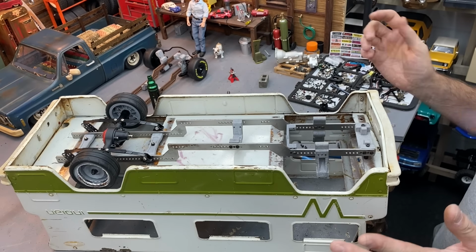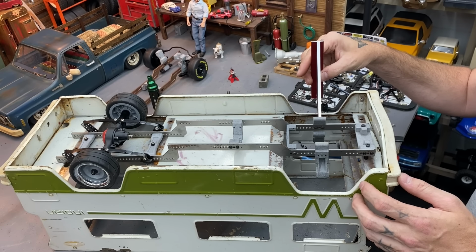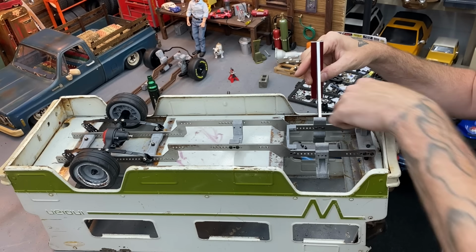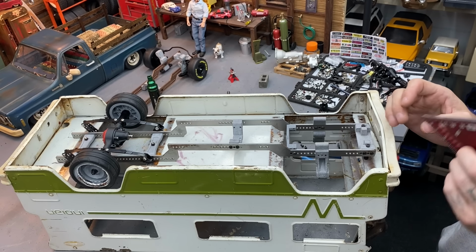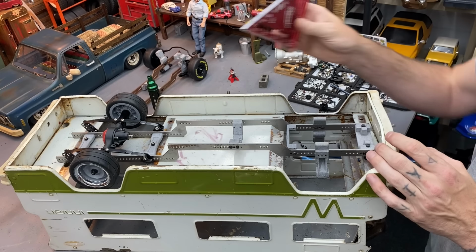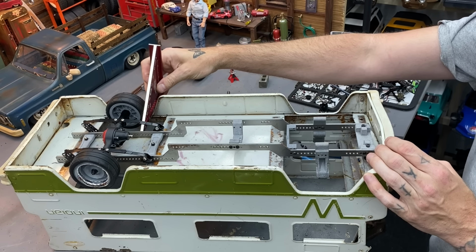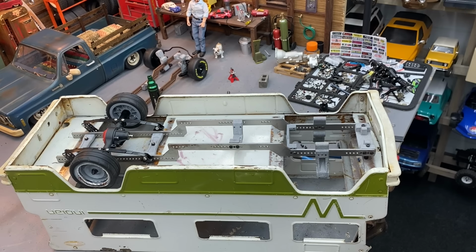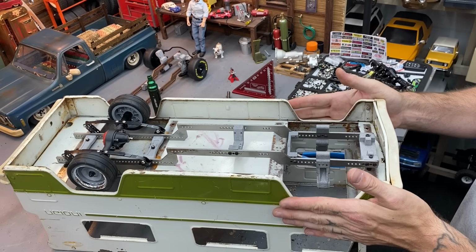Little wire management. The only thing I can recommend is just measure everything. This is right at about 2.5 inches from the inside of my shock mount to the inner part of the wheel arch. We're talking a millimeter off to the side, because drilling the holes the way I did just got off a little bit. The rear is perfectly centered. I checked it 1,000 times. Again, about 2.5 inches from rail to inside lip. And yeah, just measure, and hopefully only cut once.